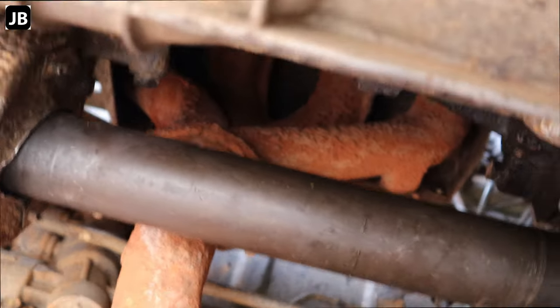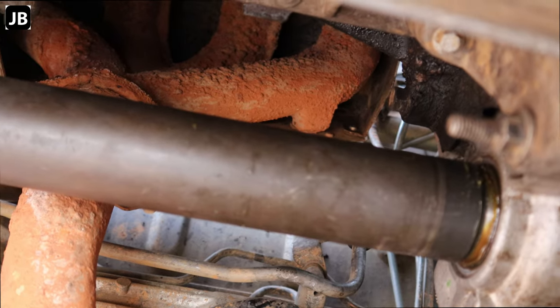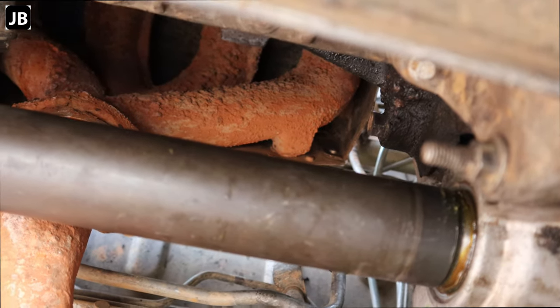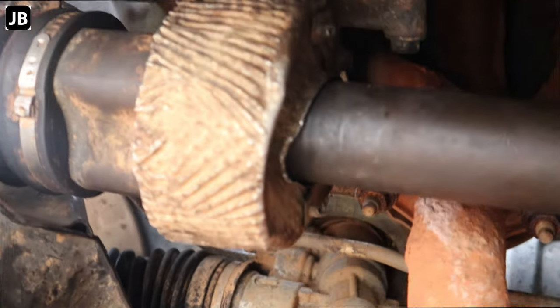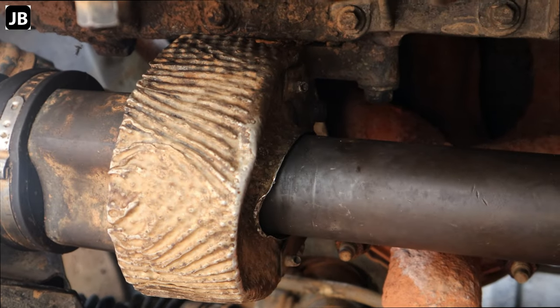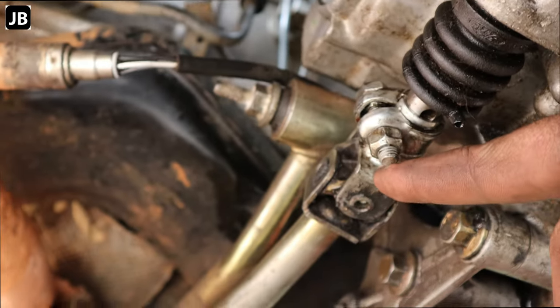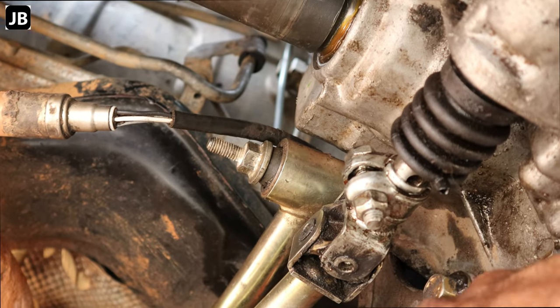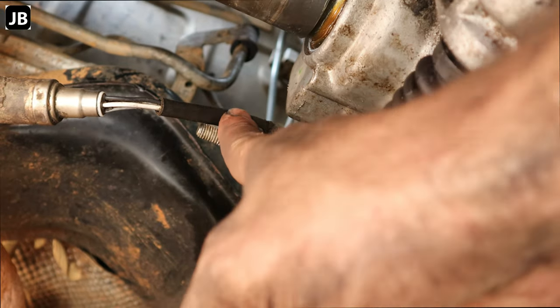The hanger bearings torqued up to 25 newton meters. Hanger bearings torqued up to 25 newton meters. Selectors on. Engine mount 50 newton meters on these three bolts. There's one up there, 55 on the stabilizer.